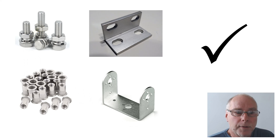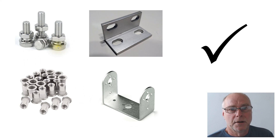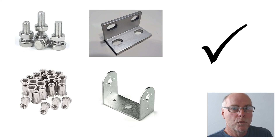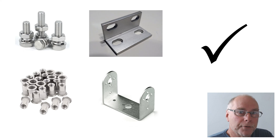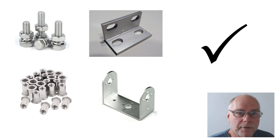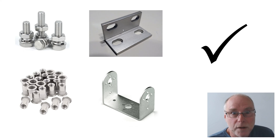For fastening, you can use nuts and bolts — I notice these bolts have flat washers and spring washers, making them much less likely to come apart. I use riv nuts. A riv nut is like a pop rivet: it's put into a hole, a special tool flares the end, and the nut becomes captive so you can screw a bolt into it. If you drill through the sheet metal of the car floor — making sure nothing's on the other side — you insert a riv nut, flare it, and you've got a captive nut. It works really well. If you need brackets, use proper quality brackets, not light sheet metal from a furniture company — proper brackets that will handle those forces.